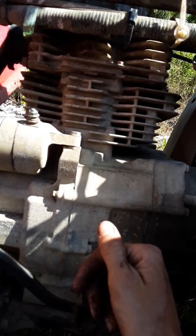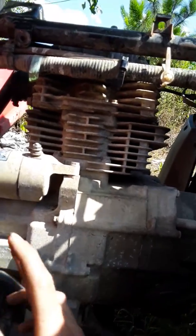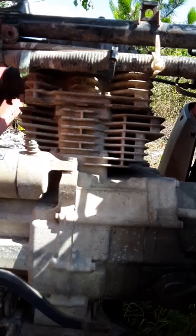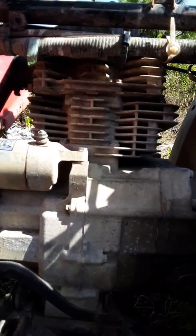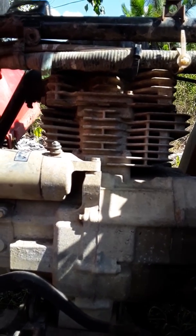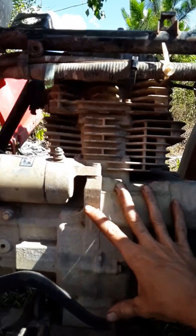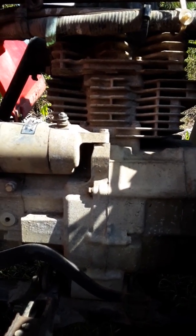So that's a pain. And after you get them bolts from over there out, there are two more on this side where the starter's at. And those two more are right here. You will fight with it to get it off if you forgot about removing the bolts, because it just will not budge. In order to do it, you have to pull from here up and off, so the rest of it will clear. And then these things are pretty heavy.